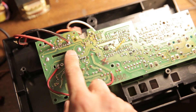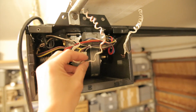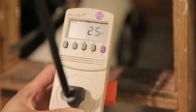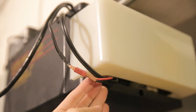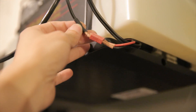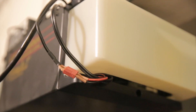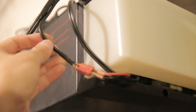This will want 20 volts and I can just connect it here to bypass the transformer. You can see AC comes out and 20 volts goes back in. The opener with the panel removed — AC comes in here, here's the wire to the remote next to the door, and these are the front door sensors. One cool thing about the laptop power supply is that standby power is really low — only half a watt by itself, and only two and a half watts with all the circuitry connected. The AC goes out to the power supply and the laptop supply produces 20 volts DC, which comes back in through a Dean's connector — similar to what's used in radio control. The original transformer's function was just to step down from line voltage to 20 volts, and this does that while also producing DC with much lower standby power.